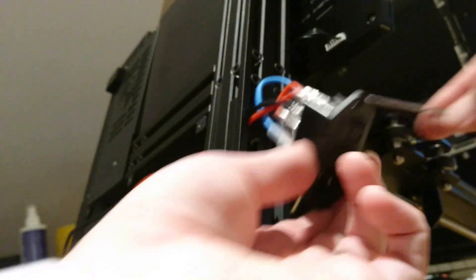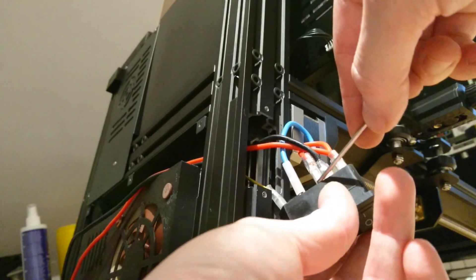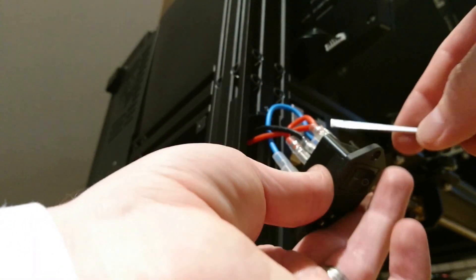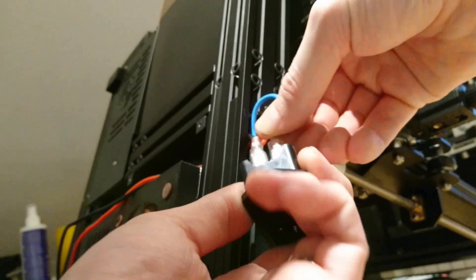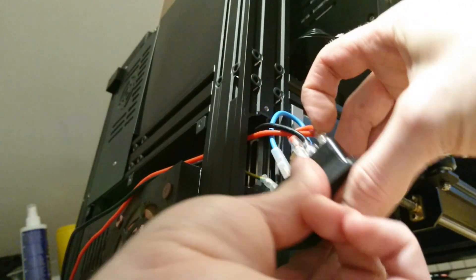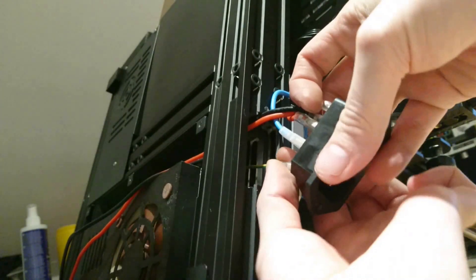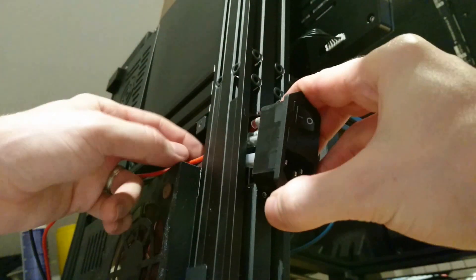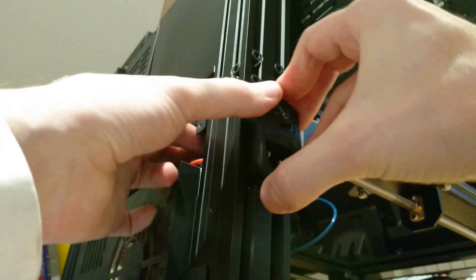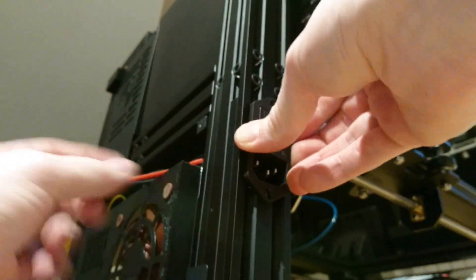Sanity check: neutral coming in, goes into the switch, goes through the switch to the other side, and down to the printer. Make sure the boots are all the way down on each one, looking and pushing. Then we have to carefully tuck the wires in here, and they will bend around the power supply a bit. That's just the way the printer is designed.